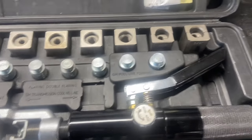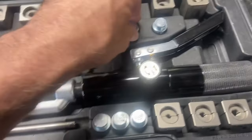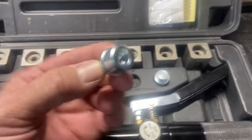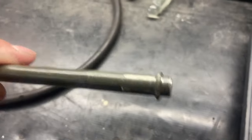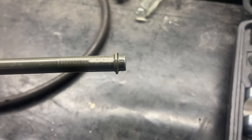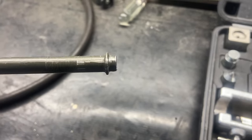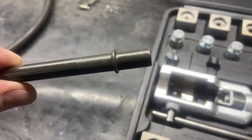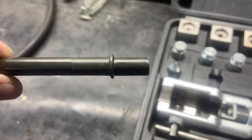Half inch I haven't used except for stainless steel lines one time, which is a pain. That's basically what you have for your double flare. Then you have your GM line form fitting - I've made a couple of examples here. I don't really think GM uses that style much because I haven't seen it that much. The ones I've seen most are basically a push lock style.